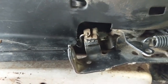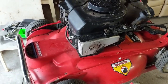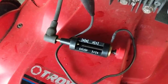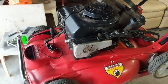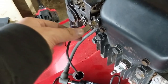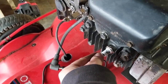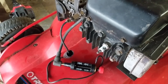This is just a quick test fit, and it looks like we're not touching. I'm going to go ahead and hook up the pull start at the top — it just bolts up underneath the handle — then bolt in the shroud and give it a little pull with my spark tester hooked up. For this test I'm using a gap-type spark tester where you can adjust the gap; the more gap you have, the more voltage is going through. That spark tester will prove my theory whether or not that kill switch was just touching the metal on the shroud. With this type of spark tester, you don't have to hook it up to the spark plug — one end hooks to the spark plug cap, the high tension lead off your coil, and the other end goes to a source of ground.